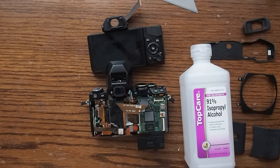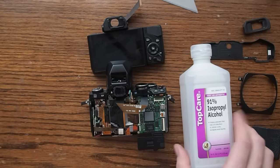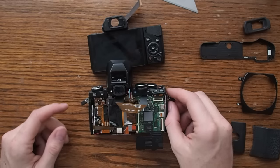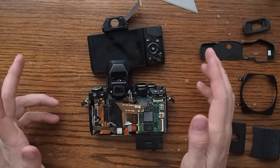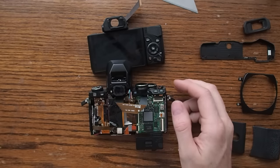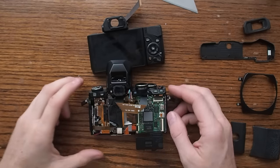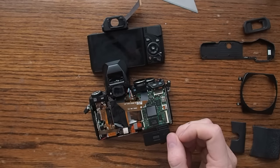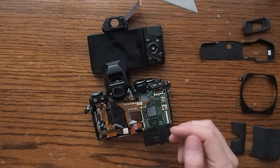I just got the isopropyl alcohol at the grocery store for about two dollars, and just really went to town — drenched the whole camera body and all the circuitry with it. The salt water dissolves in it, and it's rinse free. Then the alcohol evaporates and you're left with a clean camera body. That removed whatever short in the circuitry that was keeping my shutter mechanism from working.